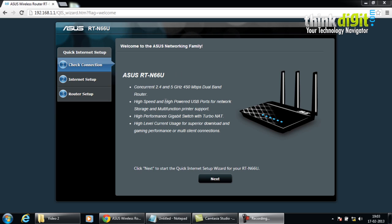You can see that this page looks very similar to what the RT-AC66U connection page looked like, as this router is a precursor to that. There are quite a lot of similarities between the two, except that the RT-AC66U was a dual band gigabit router with the 802.11ac specification, which is currently the newest specification in the market. The RT-N66U uses the previous generation wireless N900 specification.